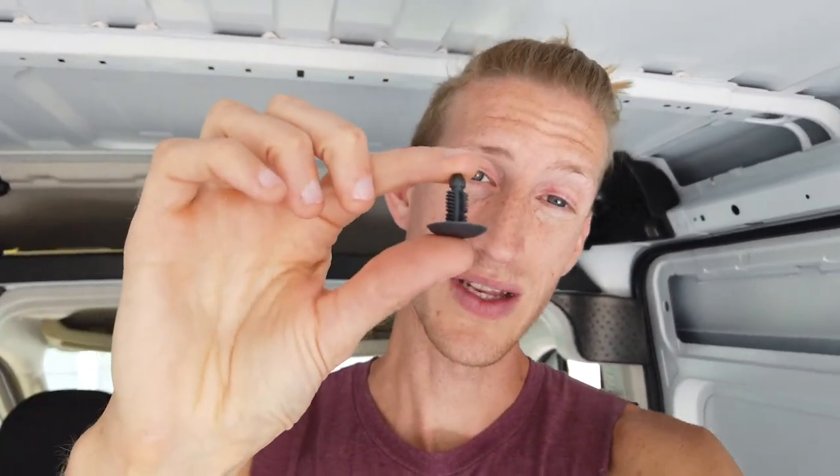Today I'm removing all the plastic paneling from inside my van. There's a big one on the side door and some on the back doors. To get them out you have to take off the little clips holding them on — they're plastic and super easy to break. Don't worry if you break some, you can get them online (link below). I've been using a small bent flathead screwdriver to pry them off and it's been working like a charm.